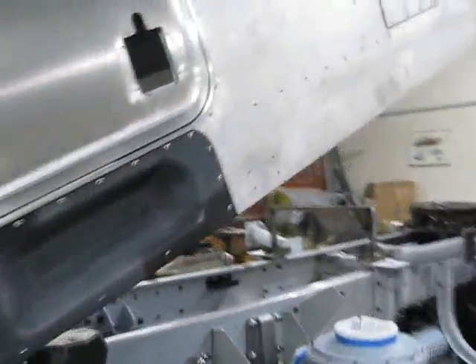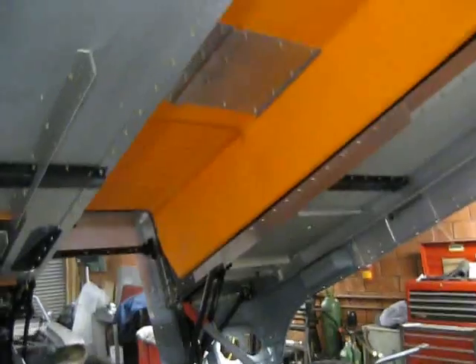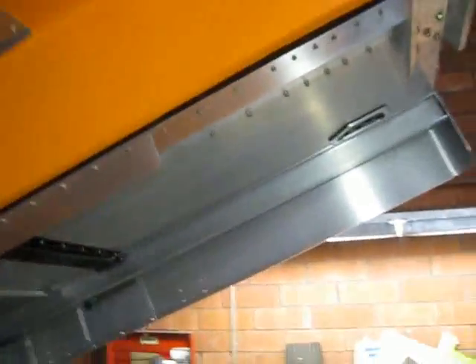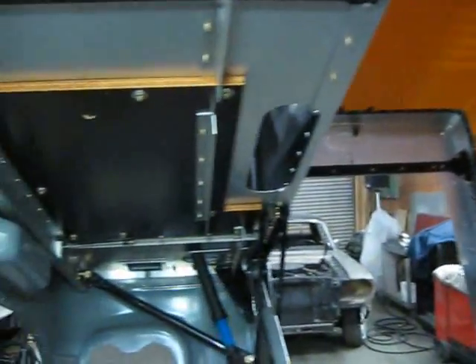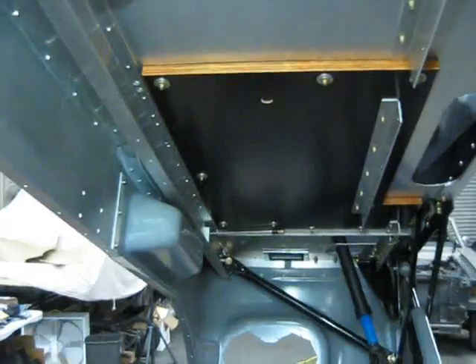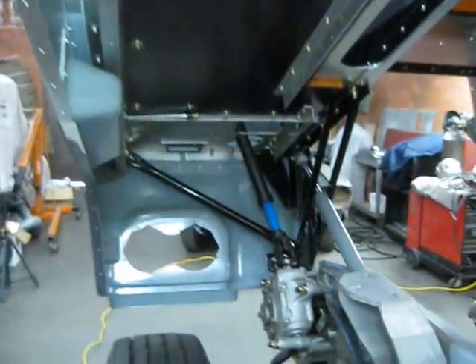The cab was really broken when I got it — hydraulic cylinder failure, floors were cracked, rear panel, everything. So I ended up getting a tunnel from another parts truck and refoaming it, and I made a few structural alterations as well. But basically all new floors, new side skins, new rear panel, NOS headlight sections, as many NOS parts as I could get.